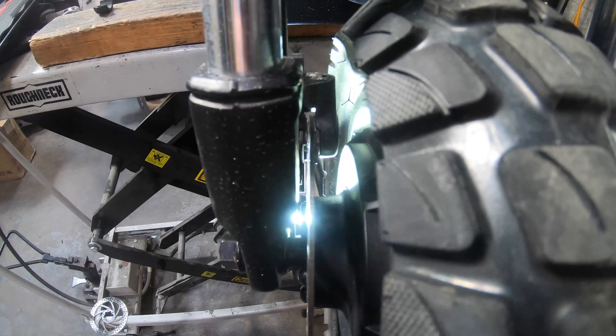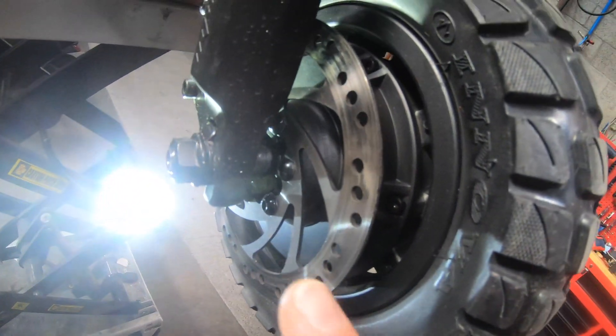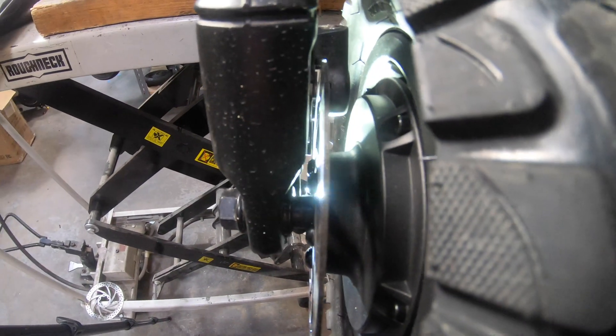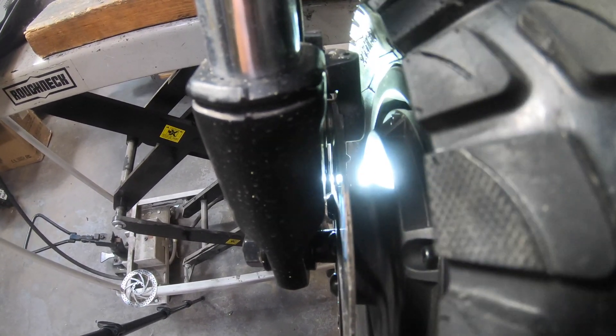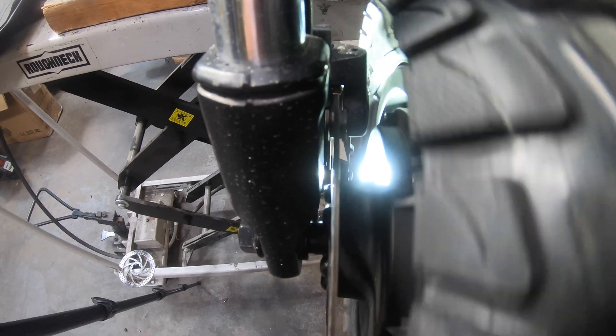I have noticed that the front motor is not spinning freely. In fact the brake rotor is so bent that I can barely rotate the motor by hand. I imagine that this additional drag along with the rider's weight could have caused the motor and or the controller to fail. So I'm going to go ahead and open up the deck and have a look at everything inside.